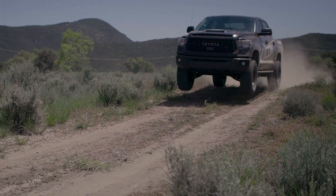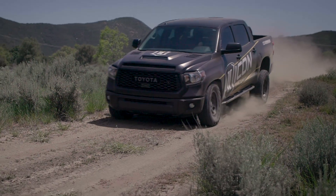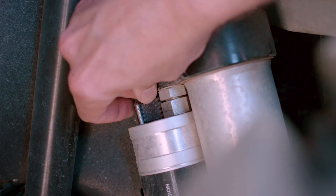When making these adjustments, it's completely okay to have different settings on the front and rear, but it's generally best to keep the same setting from side to side to avoid upsetting the balance of the vehicle. These recommendations are really more just general guidelines — the ideal CDC setting is really going to come down to personal preference.